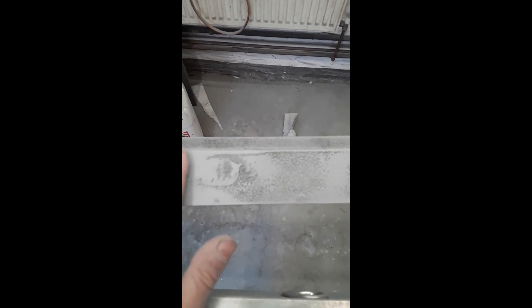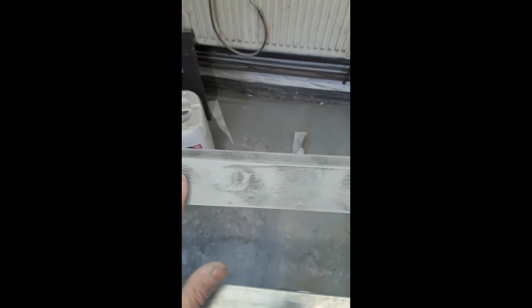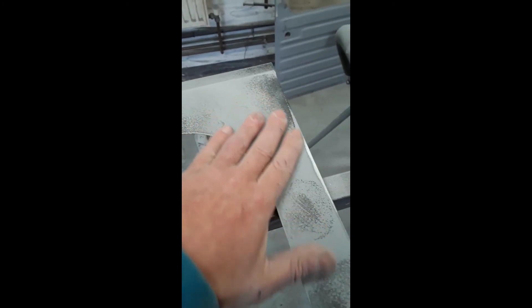It's rippling — it's probably come from the factory like it, and showing up. But I've put a little skim of filler trying to fill some of these ripples. If I glossed over that it would stick out like a sore thumb. So you either don't go to fill it, or you've got to get it flat. If you try and do something halfway in between, it just looks crap to be honest.